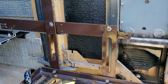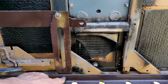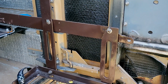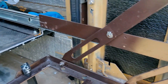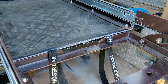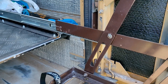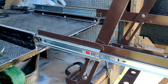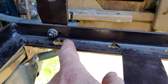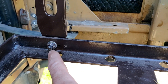I built into my drop slide a 22cm drop — that measurement is from this pin up to this pin. I couldn't go deeper because I was restricted. When you watch the swing, I come up nearly to my base plate or mounting platform in my truck. The reason I come so close is because I recycled my old 550mm runners. Had I used 600mm sliders, I could have gotten further drop and been farther out from my mounting plate. I actually had to experiment to find where the swing was before drilling the final hole for the M8 bolt — you can see I have three holes there.